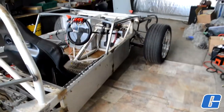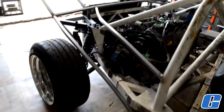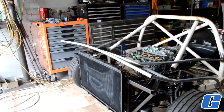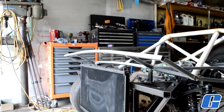Alright, so before I had my operation to get my arms free, I did a little bit of body work on this tuber. So there's steel framework going on. I just did compound bends using X and Y axis, using my hoist and some bricks. This rear spoiler, imagine that, I just flipped it upside down and had bricks on the ground, and put the pipe in between the span and just basically stood on it to get that arc that you can see there.